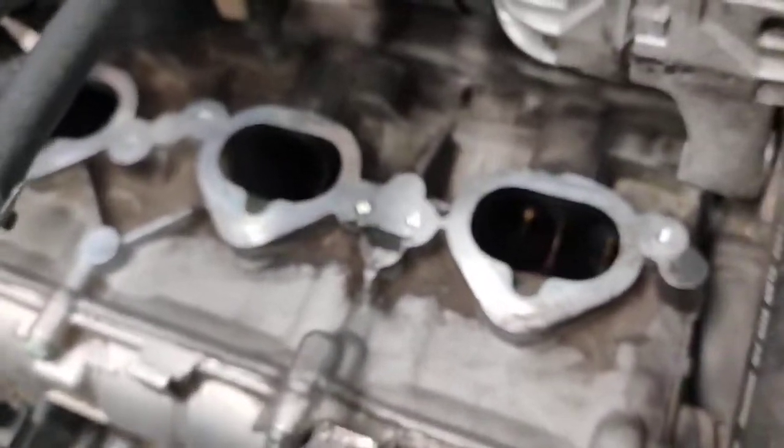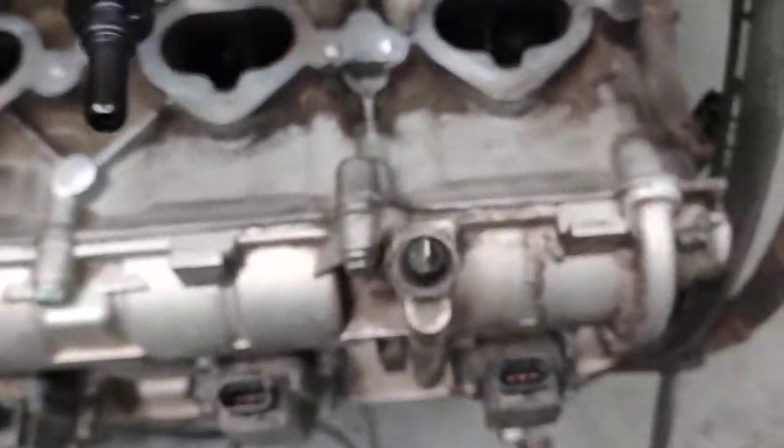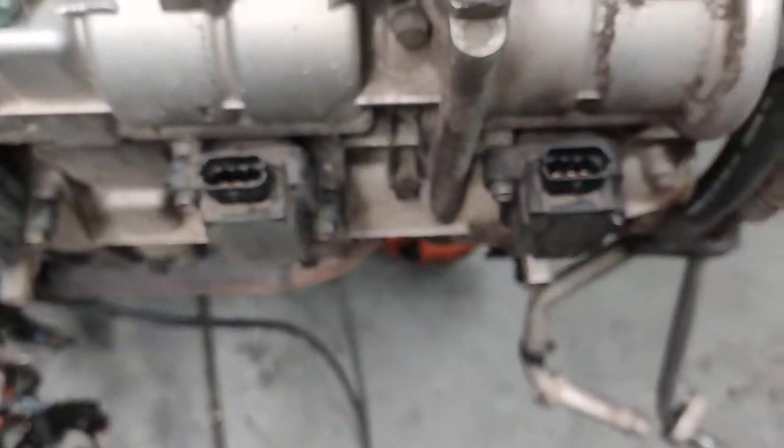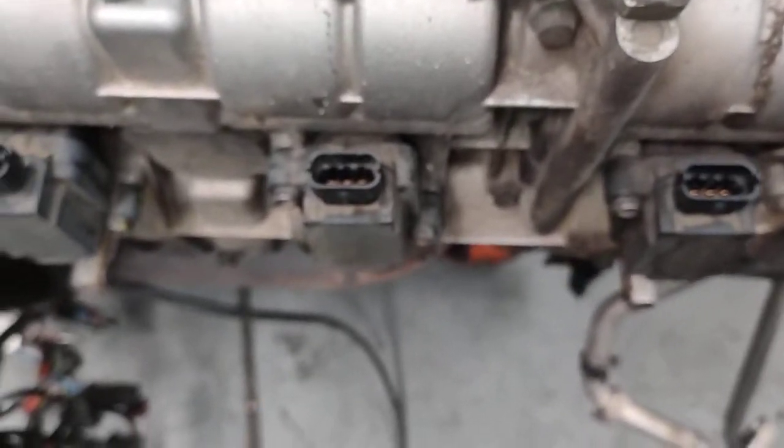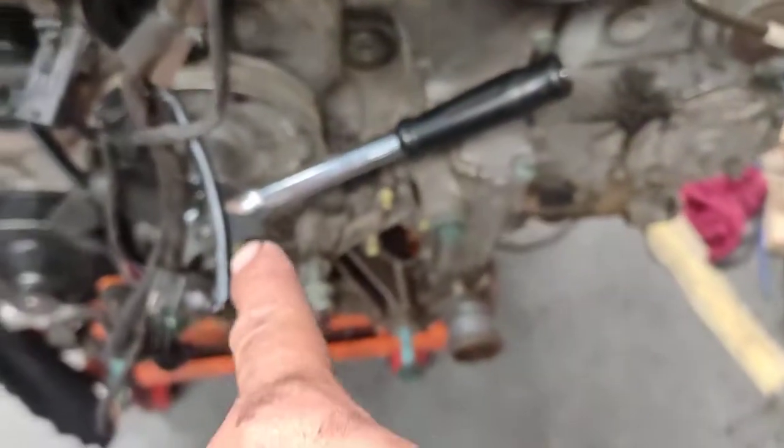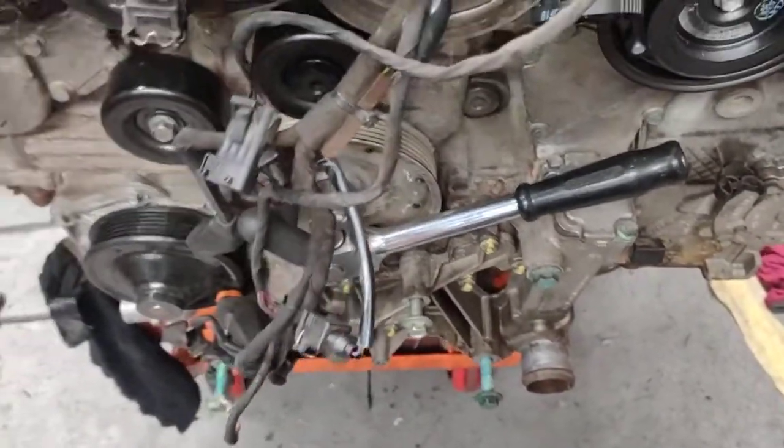This car has carbon deposit there for nearly 20 years. So I'm going to clean all that on the ports. Once I finish cleaning, I'm going to remove the spark plugs, remove all the coils as well. And I'm just going to use the crank — turn it by hand to push all the excess liquid out, so it doesn't have a compression lock.